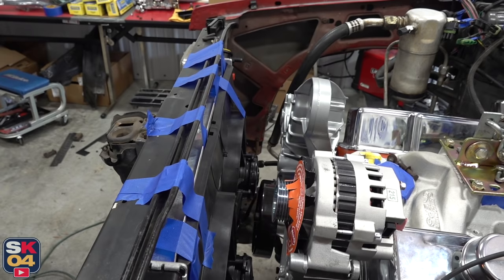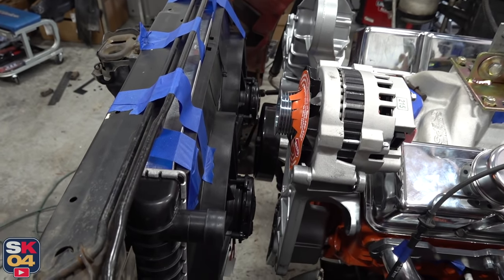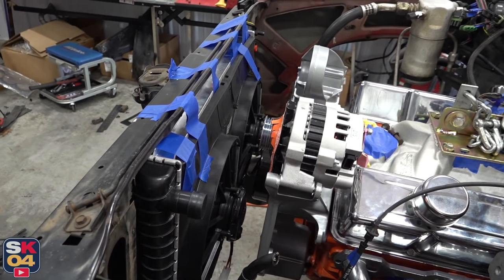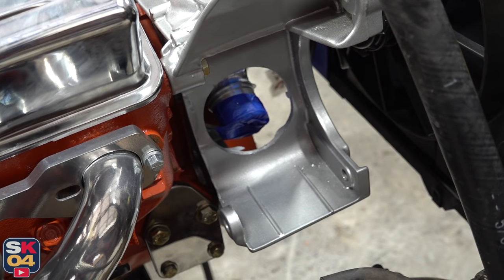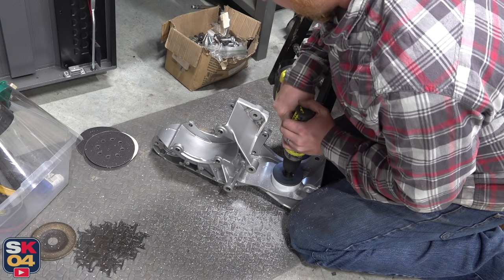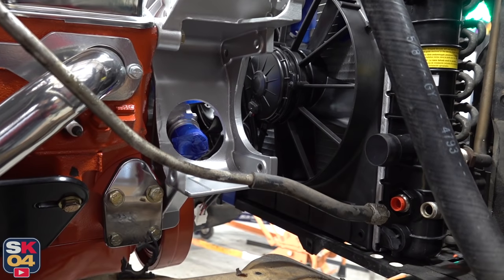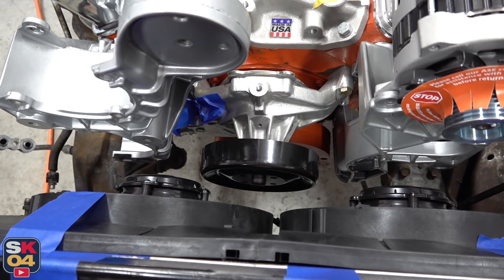I'm really happy with the clearance I've been able to make so far, but in my opinion, I still think it's way too tight. I have an idea that I'm going to try — I don't think it's going to work, but never know until you try. With the short water pump, the outlet for the lower radiator hose actually sits quite a bit closer to the engine, which puts it right in the way of this bracket. I had to bore a hole just so I can get the bracket test fitted, but it's still not quite big enough to allow the hose to get put on, so I'm going to have to do some more cutting.